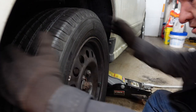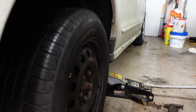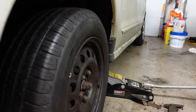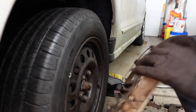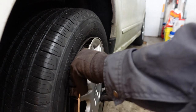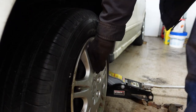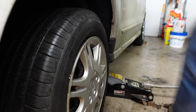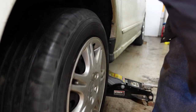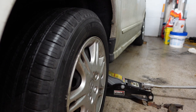If you're doing aluminum or alloy rims, be sure you do your torque spec. Steel, it's not that big a deal. But on alloy, you don't want to mess with those. You also want to re-torque them after 50 to 100 miles. There'll be a little bit of drag on the pads until you've used them a couple times and they find their center.